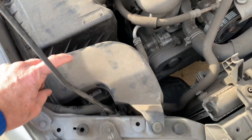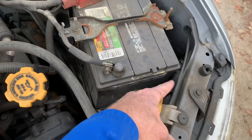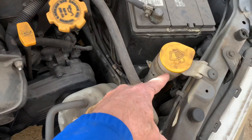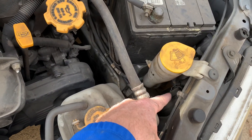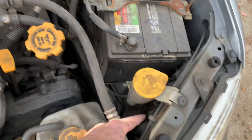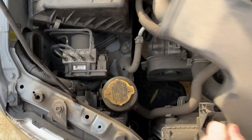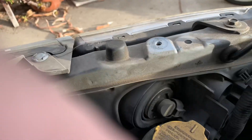On the passenger side you've got this air snorkel that's in your way. On the driver's side you probably have to take out the battery if you're trying to get to the outside light. You can get the inside light even with the coolant tank still in place. There are two different kinds of light bulbs — I'm just going to be changing the outside one. Loosen up this bolt and then pull that snorkel off — it just pressure fits off.